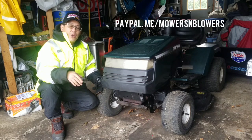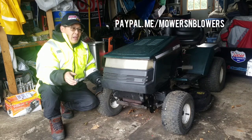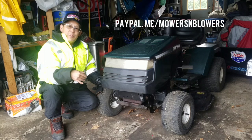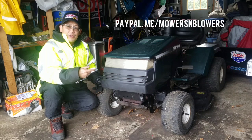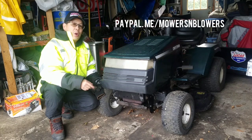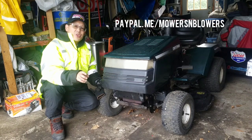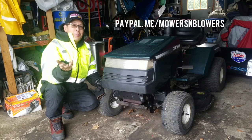I just got an email a little while ago from a guy, Mike from Connecticut. He has a Toro Wheel Horse tractor that he got cheap, and he was trying to figure out the carburation on a Kohler Command. The video that he sent me, about 4 minutes long, showed a Walbro carburetor, like for a Briggs, on a Kohler Command. He said it didn't run right, and that's one of the reasons why. He was also confused about how the throttle linkage went on that carburetor. Well, if you've got the wrong carburetor, that linkage is not going to go on there. I sent him a couple of video links, and links to pictures, charts and diagrams on how that Kohler Command carburetor would go on there. You would first need to get a Kohler Command carburetor.